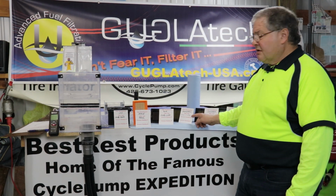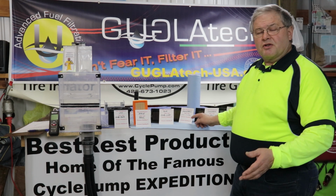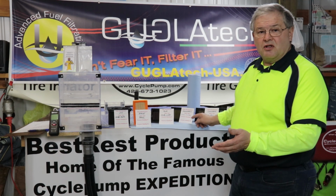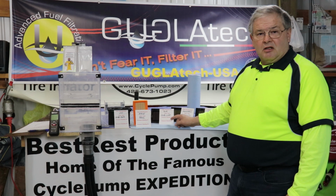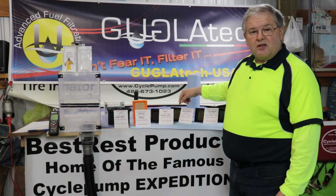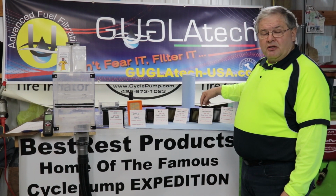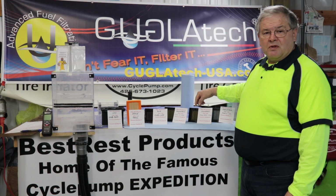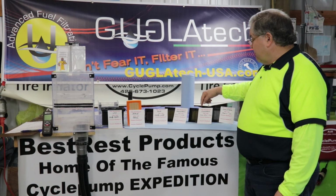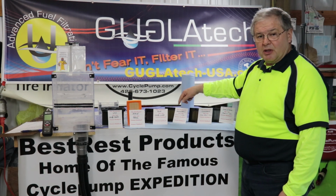We're testing a Guglatech matrix filter that's been treated with a special oil that is water soluble. This means that you can actually change or service the filter in the field using just dish soap, unlike the K&N, which requires petroleum-based solvents. This filter has been oiled very heavily on both sides, and we wanted to see how that would impact the filtration process. We're also doing a Guglatech oiled matrix. This was a filter that was sent to us from Italy for testing, and they spray only the front side. So this has a fairly light coating of the Rock Eco oil on one side only. So it'll be interesting to see how these two compare.